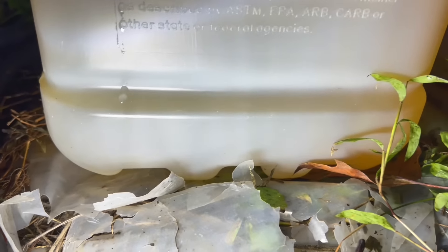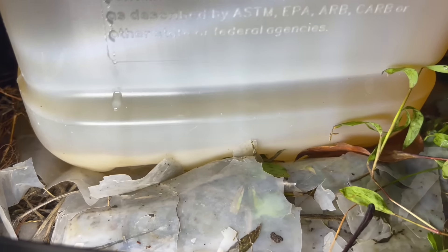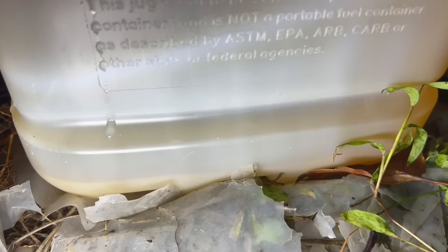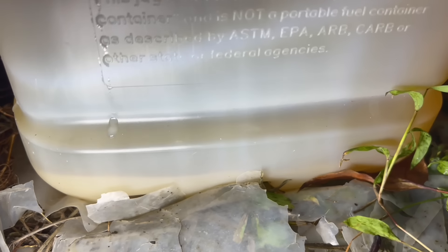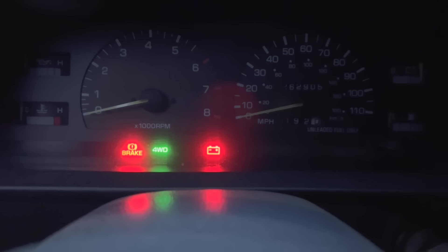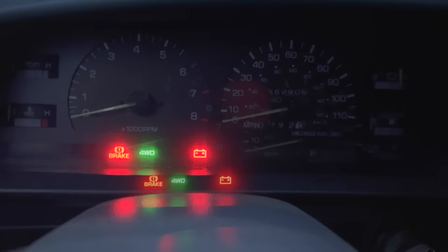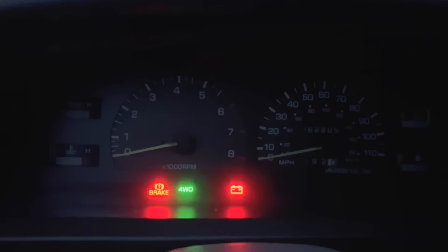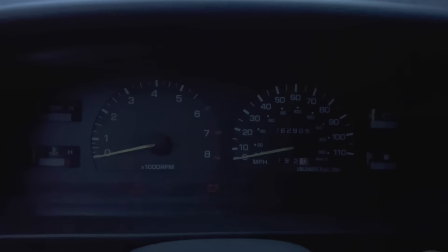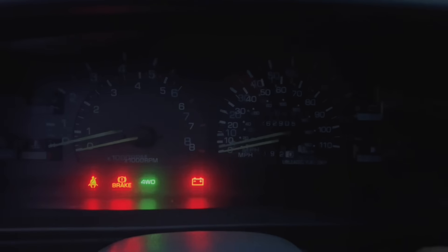That ain't gasoline. As I tilt it you can see the water at the bottom of the gas tank has already separated from the gasoline, so the lines should be ready to start. The cold start injector is bypassed right now so it might take a little bit of cranking to get it to fire, and it might take a little start fluid. It runs on starter fluid, so something probably isn't telling the injectors to fire.